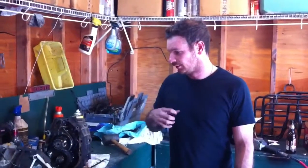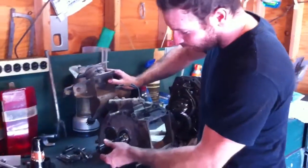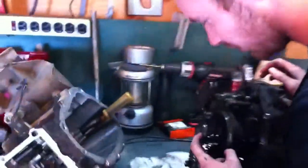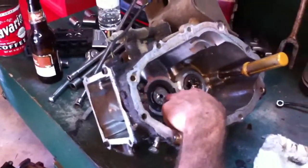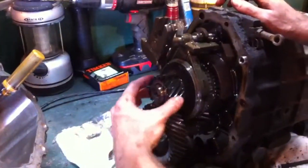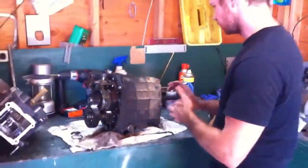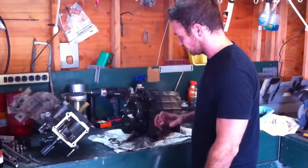So we took apart my transmission — the input shaft to the transfer case back here. That was the one giving us problems. You see it's wobbly. You can see it split the casing from it. This is the casing from the inside transmission — going back out, split the metal in half. Everything here is broken off. So we gotta pull all these gears and hopefully maybe it goes to the main shaft. We're not sure. We're gonna get a schematic and start pulling some gears and see how it goes.